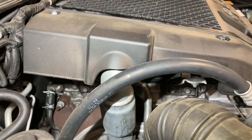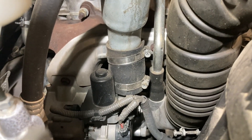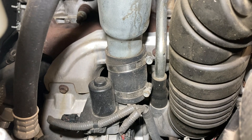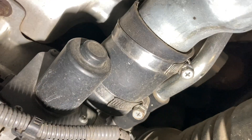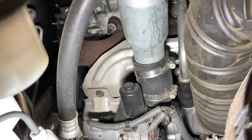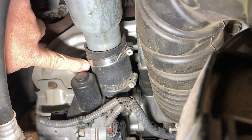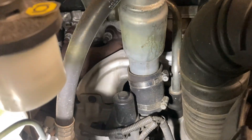If you've purchased one or are looking to purchase one, these are small things that can be fixed - not a big deal, but a telltale sign it's been worked on. You can see the bottom clamp on the turbocharger - it's pretty well where it should be - but the top one is on a big angle, kind of sideways. It's not actually clamping that hose. The clamp isn't sitting in the right spot.